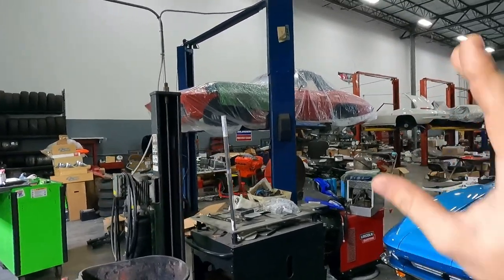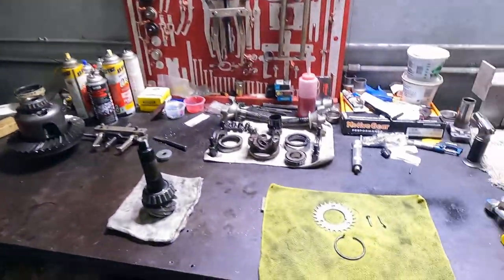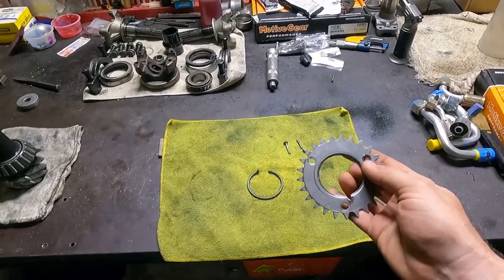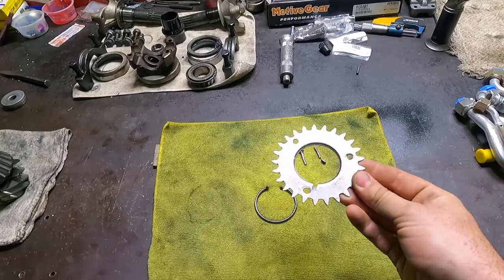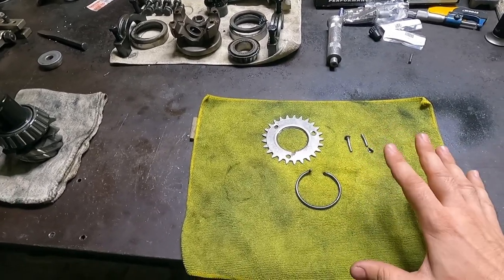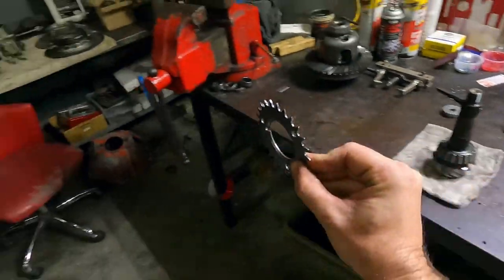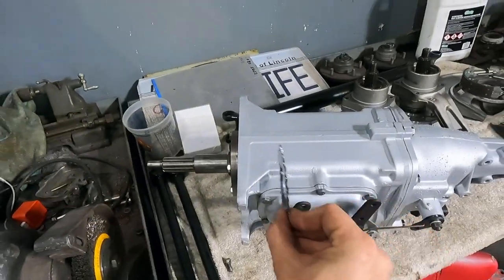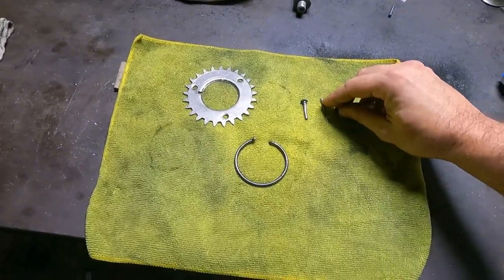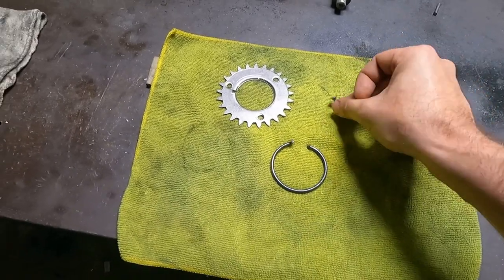Now this transmission has a really bad design flaw. This is an anti-backlash ring, and it's only found in the very latest design of the M20 on these cars. Essentially what this does is it's held in by three rivets that, long story short, back out and destroy the case of the transmission. It's attached to the counter gear, and when the rivets back out it grinds up the case of your tranny and really creates a big mess. You can see the rivet here is separated — these are the guys that just love to back out and create a mess.